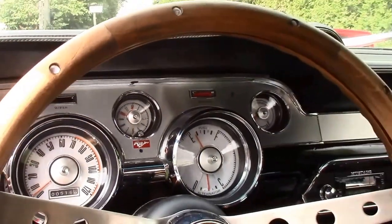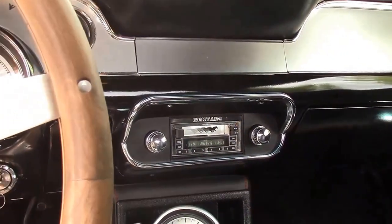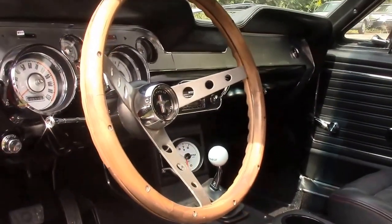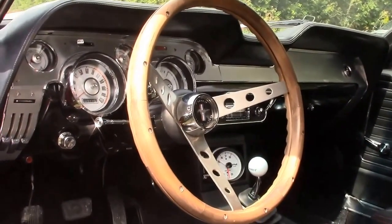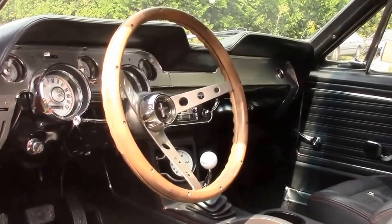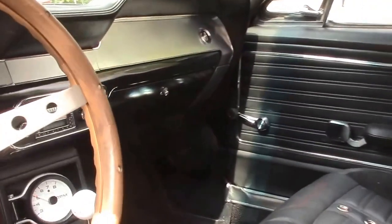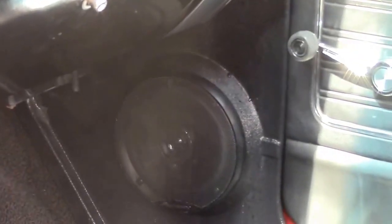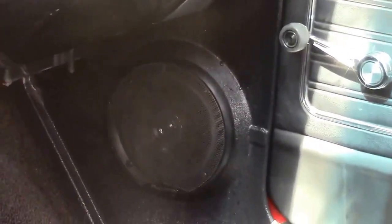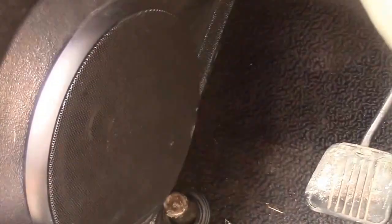To the right of that, the stereo looks like a normal plain Ford Mustang radio — typically period-correct looking for 1968. However, it's made by RetroSound and it's fully electronic. As soon as you turn it on it becomes digital, with MP3 and all that sort of neat stuff for plug-ins. On the passenger side, we've added custom speaker pockets in the kick panel, so typically that would just be plain plastic — we upgraded with five-and-a-quarter inch speakers in the toe panels, both driver and passenger side. The rears have a new deck with six-by-nine speakers on either side, which gives it really nice sound.